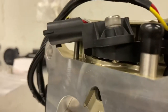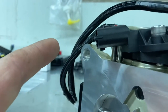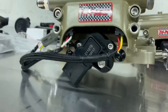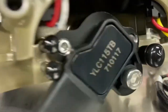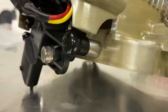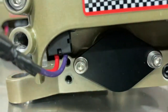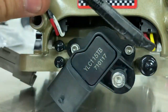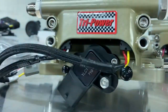Not only does this sensor hang way down, but they've also installed it so that the base plate comes down at an angle - so by the time you put the plug in, which sticks way out, it's sitting right into the intake manifold. I'm gonna have to resolve that; it's just gonna be a pain in the neck. There are vacuum ports here - that one's for the brake booster, the other one is blocked off, so this one should go in the front so you can get the vacuum lines on.